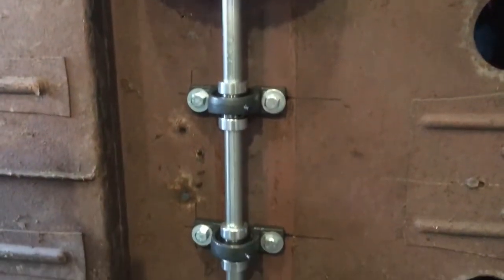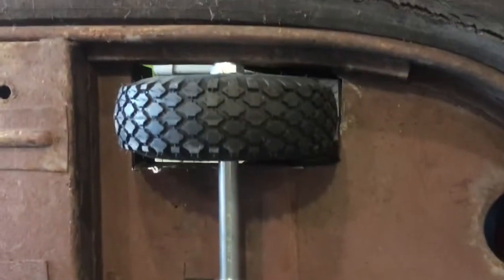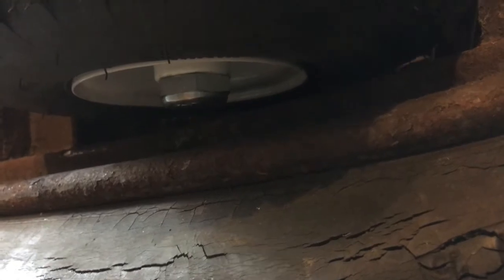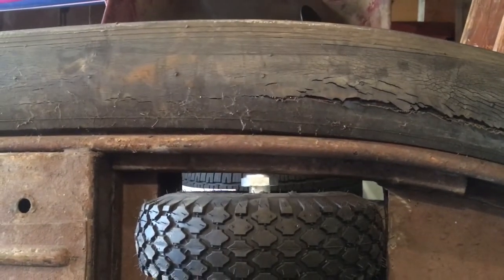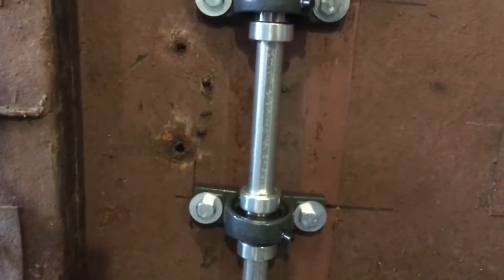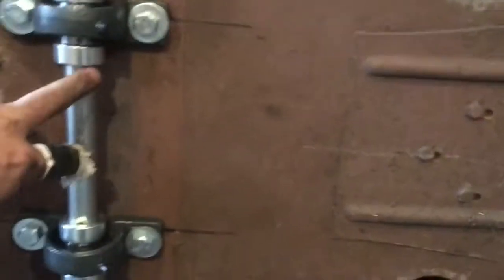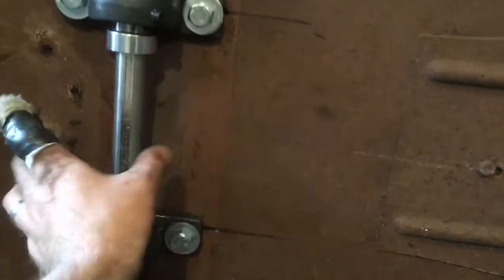My gear will come in Monday, and then we can put this on its side. Once I get the exact measurements figured out, I'm going to go ahead and tighten this nut down. It's only protruding out from the nut maybe like an eighth of an inch — just so it's all the way on there. They are lock nuts, so it should hold. Hopefully my geometry is good on this. I measured pretty accurately and drilled everything as accurately as I could. There's not a whole lot of room for the sprocket to go in here because the motor is going to be right here, and my chain is going to run down to my sprocket. So I'm going to have to cut out a nice big slot right there for the sprocket and run the chain.